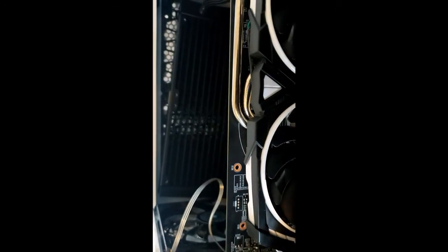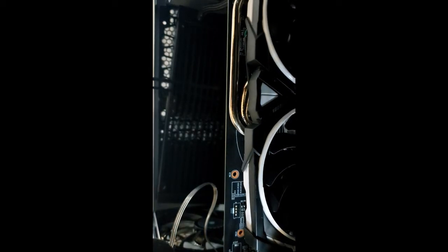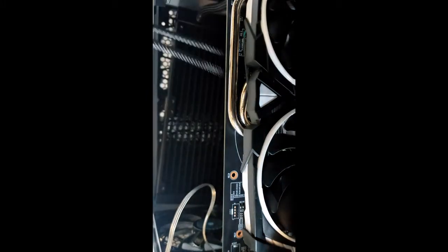I just hit the back plate. That's okay. Just get one of the fans ready. Set it like this. I'm figuring out how I want to route the fans. If I pass them back there and I can pass the plugs behind the case, I think that'll be good. As I set the cable, make sure the fans mount like this, and then pass through underneath here where the 8-pin power connector's at. So I'm just gonna get one screw to start with so I don't complicate things, because I complicate things so easily.